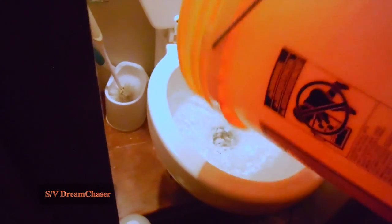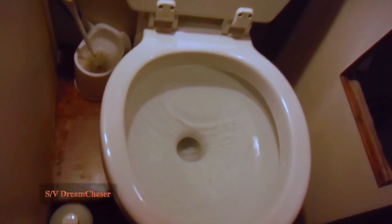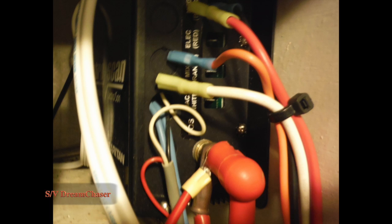When the time has elapsed, it's now time to flush as much fresh water as you can through the system. The manufacturer recommends a minimum of 10 flushes, but you need to do this before you reconnect the three wires — the red, white, and orange — for the macerator, the mixer, and the electrode elements themselves.